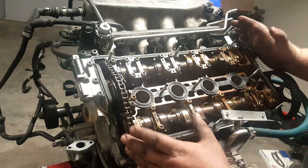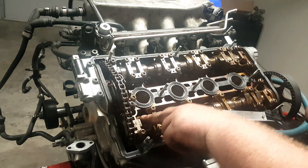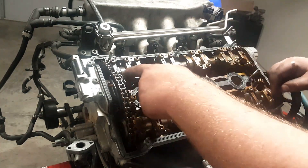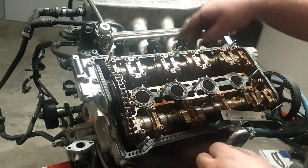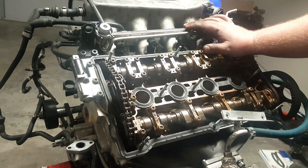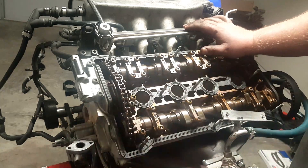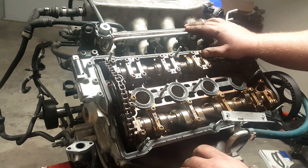You've got four cylinders and five valves per cylinder. As you can see, you have two valves per cylinder for the exhaust, and at the intake you've got two on the outside and one extra in the middle. The two at the exhaust are like this, and the one in the middle is at an angle. That's why these engines are called five-valve or 20-valve — for example, the Audi B6 2.7 biturbo engine also has five valves per cylinder.